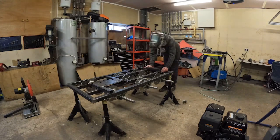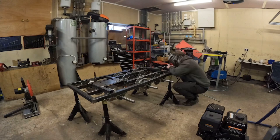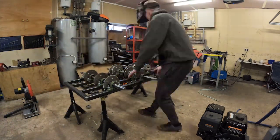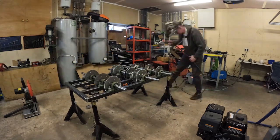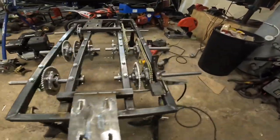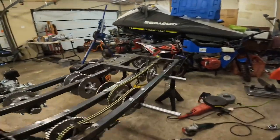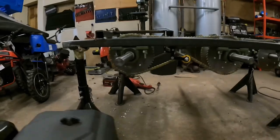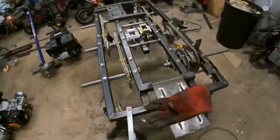I was waiting for a sprocket and it came a few days later - the postal service around here has been pretty diabolical. This is me putting the front engine mount on and tacking it all on - I missed a couple of bits on the back side so I made sure I got them as well. I made the gearbox mounts and also mounted some chain tensioners underneath to keep the tension on the chains. I did later change these because I kept hitting things with them and they kept breaking, so I mounted them solid - but we ended up breaking it anyway, so I'm going to have to rethink that.